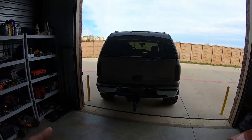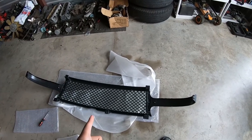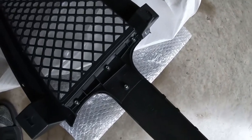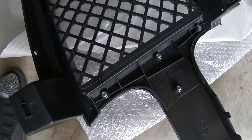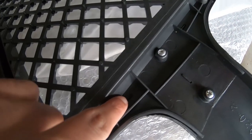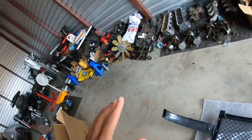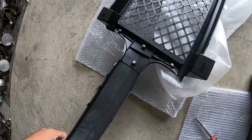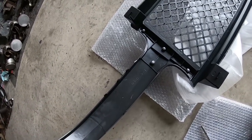What I'm about to do is turn the Tahoe around and figure this out and throw it on. I have the grill flipped over — to install the little side pieces, there are four screws. You just need to line it up; there are also some little tabs that come through to help you know when it's lined up. It's very self-explanatory. As you can see it's pretty secure, a little flimsy but I think it'll hold just fine — they're just there to fill any gaps.